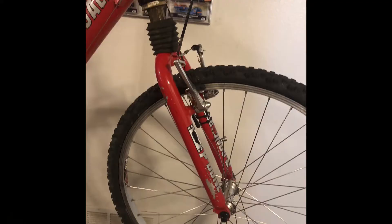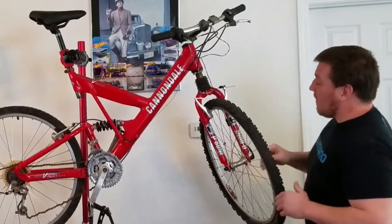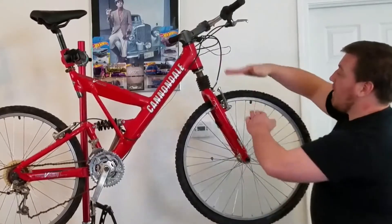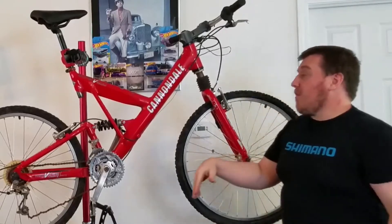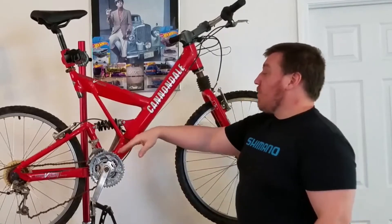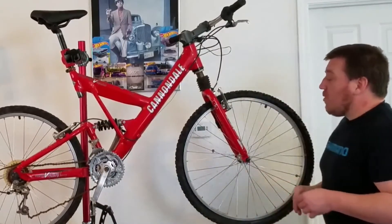What we have here is some very cool and weird old technology. It's a Cannondale head shock, and as you can see, this is not turning smoothly at all. Pretty cool design. What it does is try to reduce stiction — this is before the technology of lockout forks, where you could just twist it and it doesn't move anymore when you're trying to climb, because that reduces the waste of power. They also had the same on the rear shocks on higher models to avoid pedal bob.